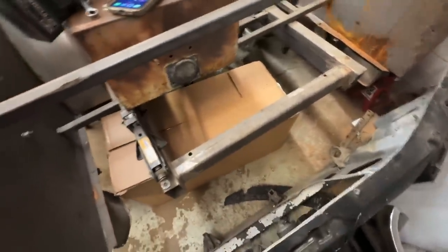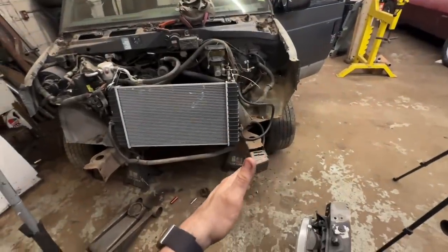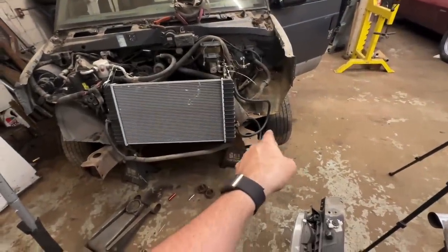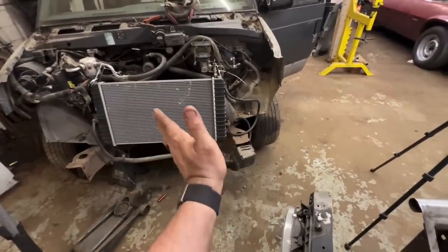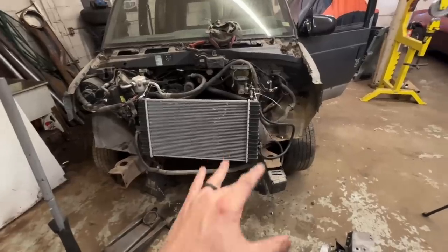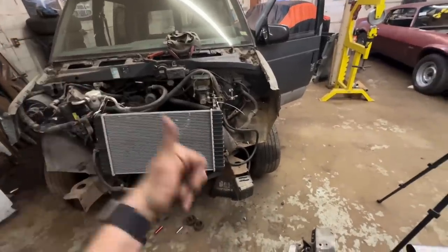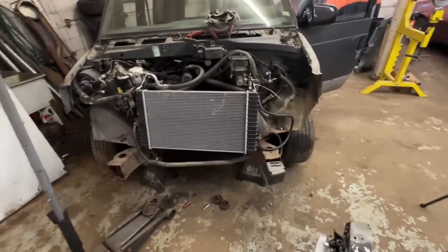And then I'd like to get the front end figured out and get tires changed out. Oh, I forgot I have to adjust the tie rods because of the drop spindles. Now my wheels both point out, so I need to bring them in. I might do that too while I'm here. And I really want to get the front end put back on so we can get our bumper fitting and all that, and then we can start figuring out paint and stuff, but that's a ways down the line.